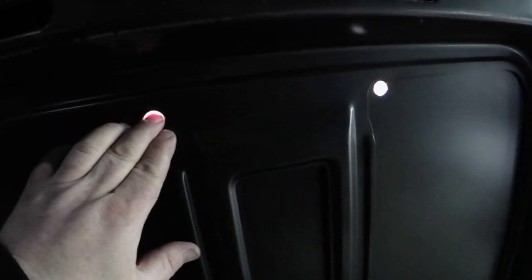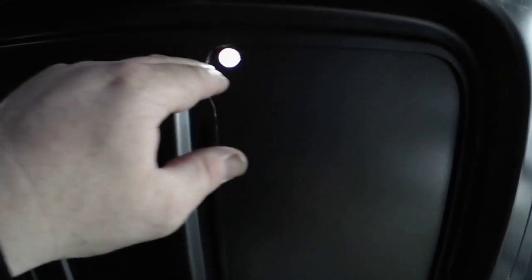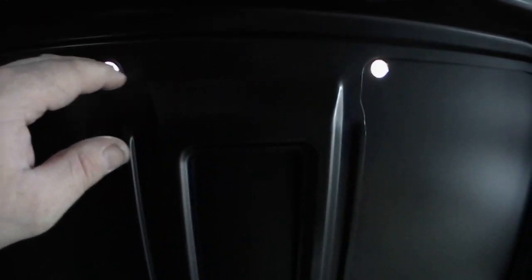To enable you to have a perfect opening for your window, I come on the inside by this strengthening spar and drill holes — this lets me know where the double skin areas are. I'll also drill in the corners. This area here that I'm pointing out is where your trim fits — your knock-on trim. What I do is, once I've got the window out, I'll put a sacrificial trim on there, and when I mastic up it doesn't matter if mastic sticks to it, because when I rip it out it'll bring that little bit of mastic with it.